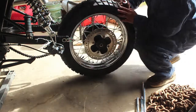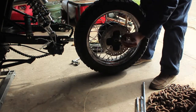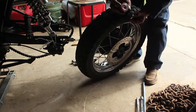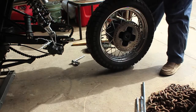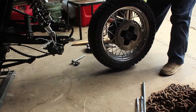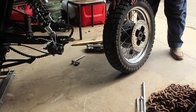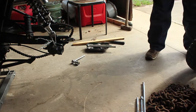Take the tire off. On the brake side you've got a washer here and the bearings, and on the other side you pull off a shorter hub. That's it - put these away. You've got your rear tire off. Now send it off to the tire guys and have them remove the tire for me. Alright, thanks for watching, hope that was helpful.